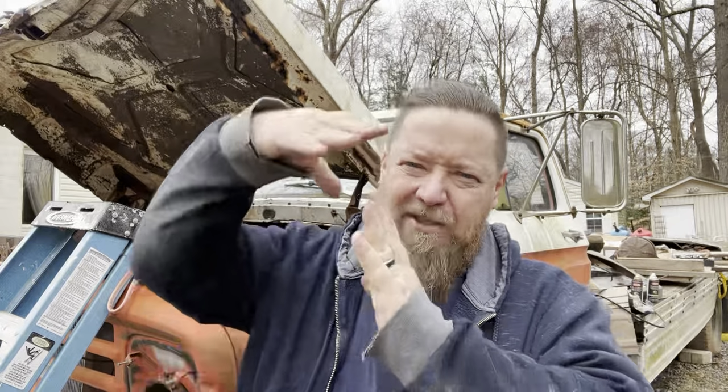I'm not gonna say they're not as good. They're just as good, but they're not as efficient as drum. Drum brakes are the most efficient because you're putting the pressure outwards against the drum, whereas on disc brakes, you're trying to clamp something that's sliding between it, which makes an extreme amount of heat. Now, the disc brakes are able to dissipate the heat real fast.